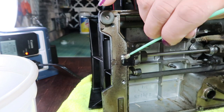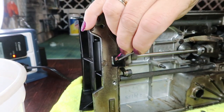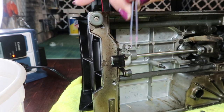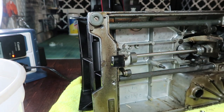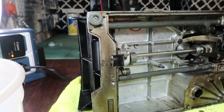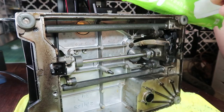When I purchased one of my other machines, they said they couldn't get it working. The reason it wasn't working is because there was a clump of thread from years ago caught up in there — in that little area where the bobbin is but underneath. Thread can get caught, so you need to make sure you check and clean that area. She's real clean but also very dry.